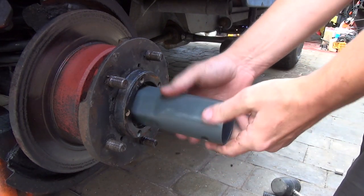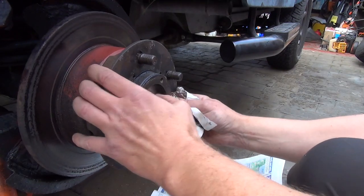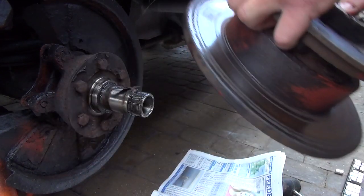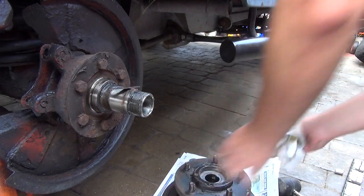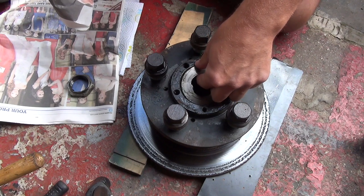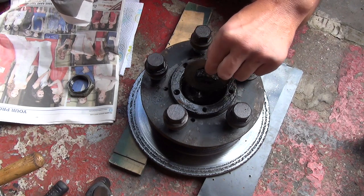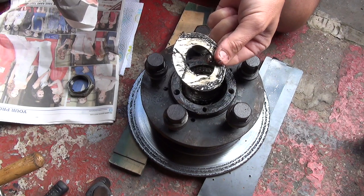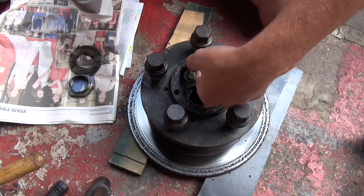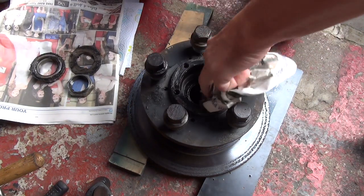I would renew these nuts regardless of how old or damaged they are — nut off. I'm holding the center of the hub so the bearing doesn't fall out as I withdraw the hub. That's the thrust washer — keep that, replacing it only if damaged or scored too badly. The grease looked a little contaminated so the hub will need cleaning out. That's one of the bearings — well lubricated; if anything, I think this had too much grease in it.